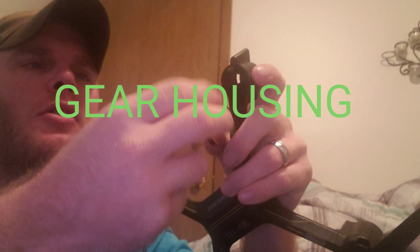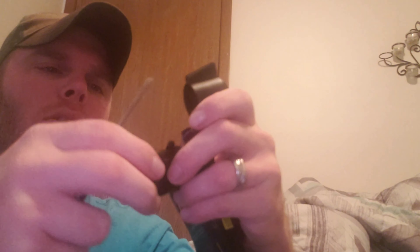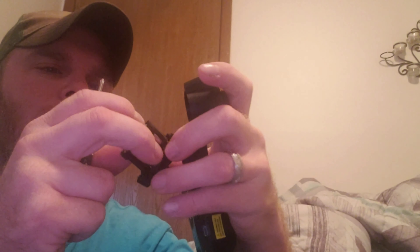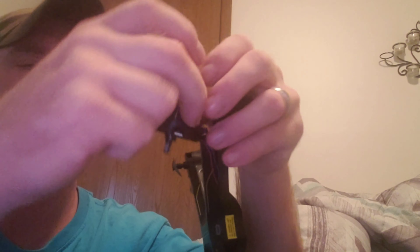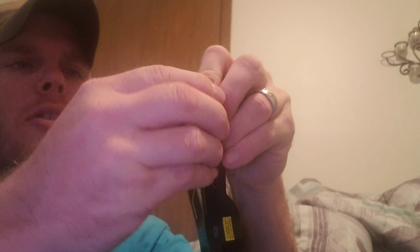Lock. And voila — there's your gear right there. You can push the motor out. You gotta take this top cap off here, just kind of pull straight out. There's that. Here's the motor. So just pinch it — it slips right out. And there's the gear.